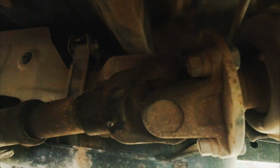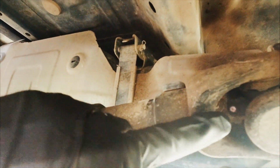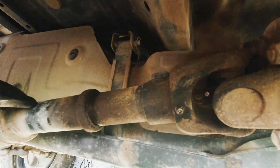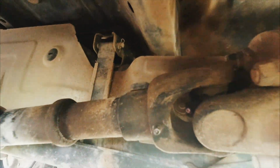It's one of those jobs that's real easy to forget and makes a massive difference to the long-term reliability of your vehicle: your grease points. Chucking a little bit of grease into these guys means that your uni joint and prop shaft should last far longer, and is pretty important when you're going through mud and sand and off-road and stuff like that.